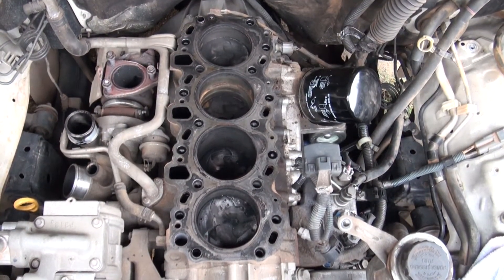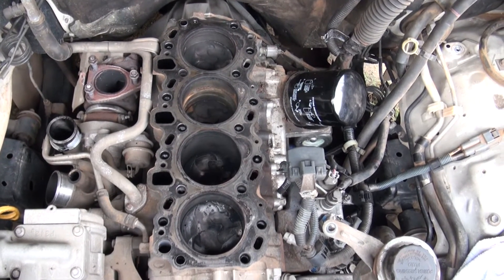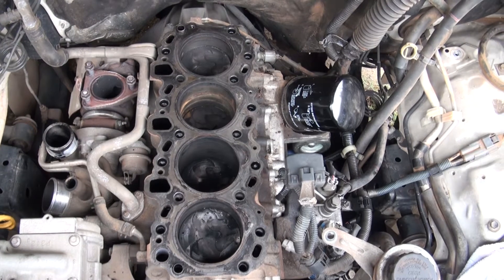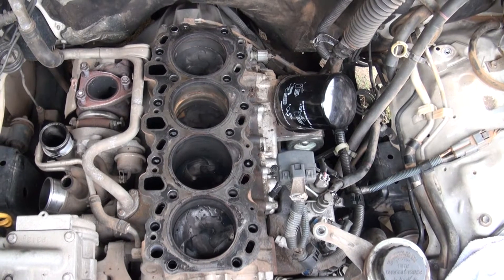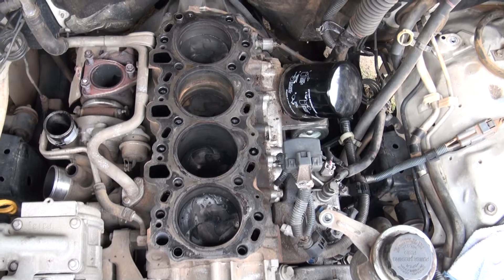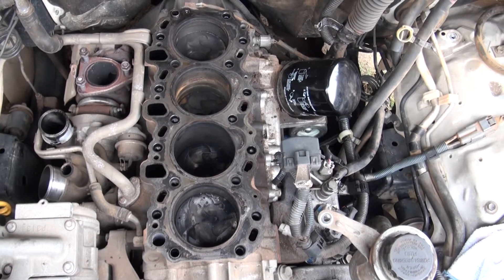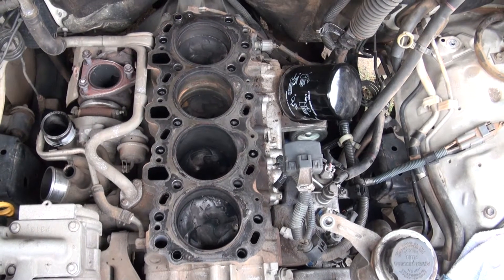The head has been sent off to get a new head and all the stuff transferred. I'll run some tape around inside the pistons just to stop stuff falling in and getting in between the pistons and the block. It's pretty tight. Then I'll sand that third piston with some emery paper to get the rust off, and then I'll also clean up the top of the block. I'll clean up the bolts as well, give them a full cleaner and put them in the holes just so as I'm scraping the top I don't put anything into the holes. It'll minimise that risk.